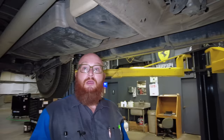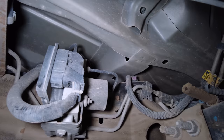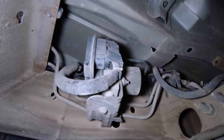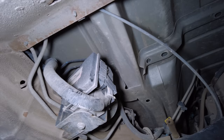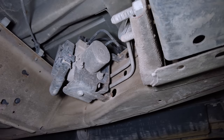Show of hands — how many of you with a 2000-2010 Chevy truck have your ABS and brake light on? Almost all of them do. The reason is the ABS module, which is underneath the car on the frame below where the driver sits. Typically the solder joints inside the control module fail or crack, it loses power and shuts down, and you get the ABS light. You can usually remove the screws, take it apart, re-solder the circuits, and fix it. I've done a lot of those myself — re-solder them, put it back together, and the ABS light goes off. It's a massive failure point on these.